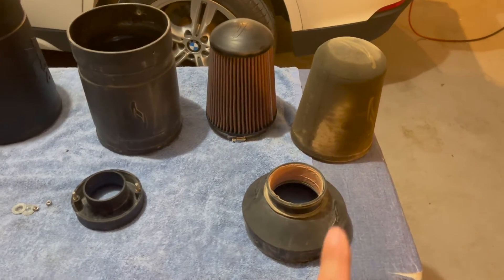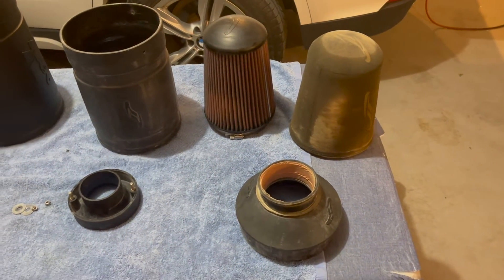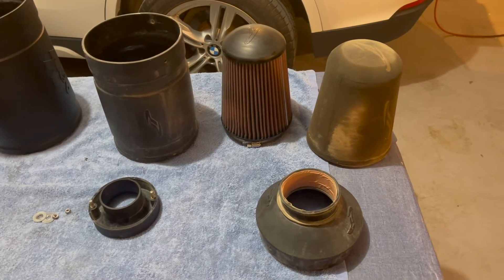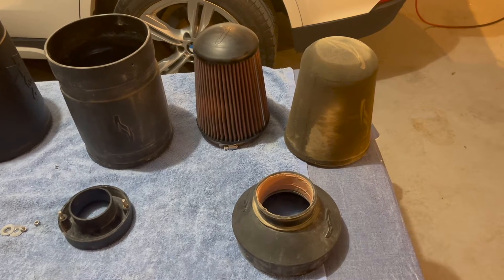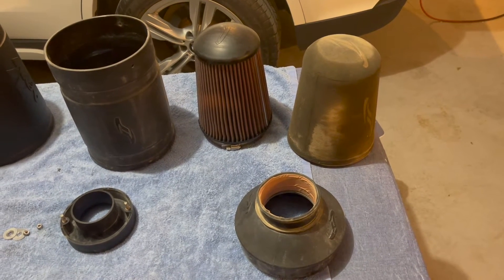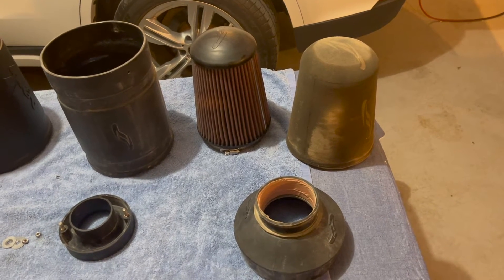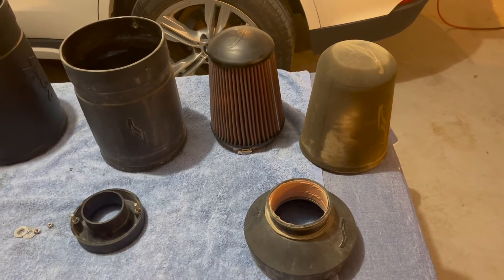Here's the Jackson Racing canister, filter, foam sleeve, and lid — everything I'm replacing. I'm doing away with it because it is letting way too much fine particles through and into the intake system. I spent a lot of time on the phone with K&N and they basically said I shouldn't be using this system in an off-road setup. With a 97.2% efficiency rating, it's just letting a bunch of stuff through.